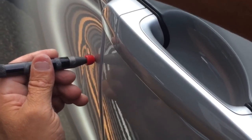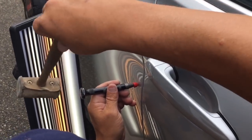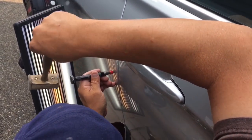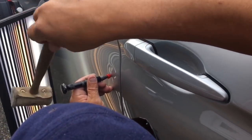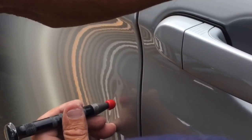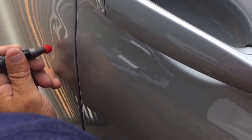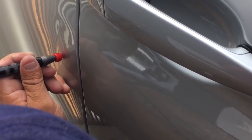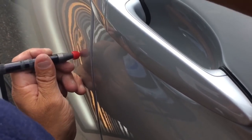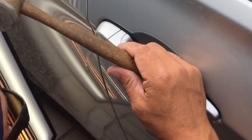I just saw that little hole and I know that sometimes I can get up to half of this dent with my J hook. I'm up in a weird little tight area up top. If you're new to the channel, definitely hit that subscribe button — we sure love to see the community grow. Feel free to leave a positive comment down below. This is kind of a sharp one — once we got some of that metal moved, it sharpened up. So I definitely have to bring it back into more of a dent before I make any more pulls, because I don't want it to go sideways. Lots of tapping and lots of pulling to be done on this one.